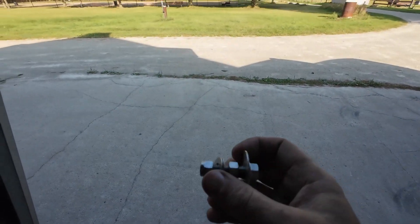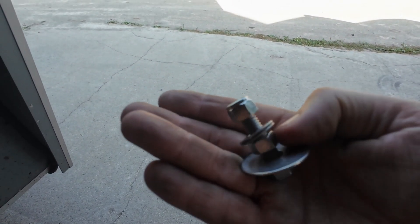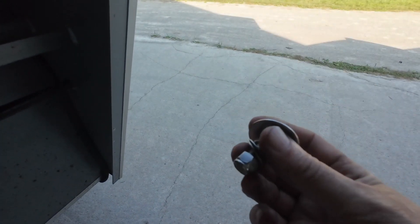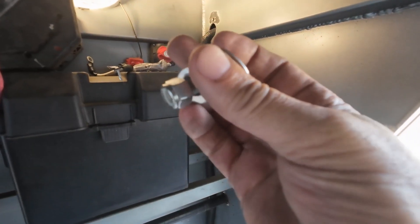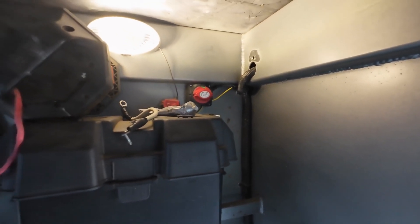Here's what I came up with. I've got a hole drilled in the tube of the frame, and I'm going to take and put this bolt package in there. This is a stainless steel bolt with 316 stainless nuts and washers, and that is going to go into that hole and be a stud. You just got to remember that the ground has to be able to handle the amperage from two batteries — and this wasn't going to cut it. Once I got this in and smacked it up full of dielectric grease with the surface ground, we're going to have a good ground.